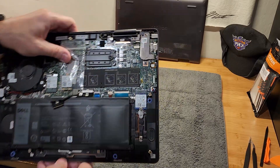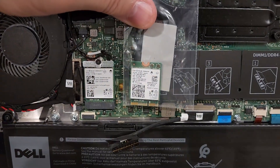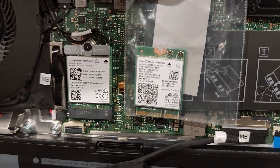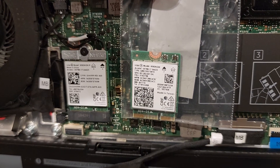Here's the existing card and the new card. The colors are reversed but the labels are the same. These wires are the Wi-Fi and Bluetooth antennas. If you reverse them, you may suffer from shortened range for both frequencies. The best practice here would be to follow the label, not the color — the wire on the left should stay on the left and so on.